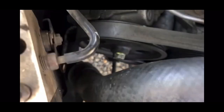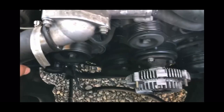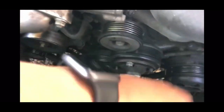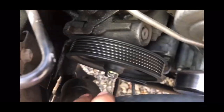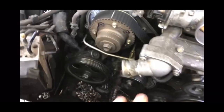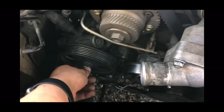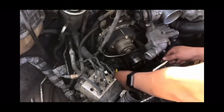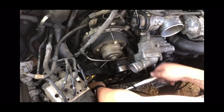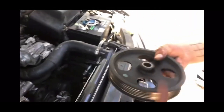For the power steering pulley — if yours is pressed on and isn't held on with a nut, you'll have to change your whole pump for one that is held on with a nut, or you can't use this. Luckily mine is held on with a nut. First things first, get the belt off — 14mm right here, pull up, slide the belt off. Now I'm going to get my power steering pulley off. It's a 17mm. I'll wedge a screwdriver in one of those little slots to keep the pulley from moving, then turn it to get it off. I pulled a hose off just to have a little more room. Push it to the side — don't want to spill too much coolant. Mine came right off, but you might need a puller or just manhandle it.